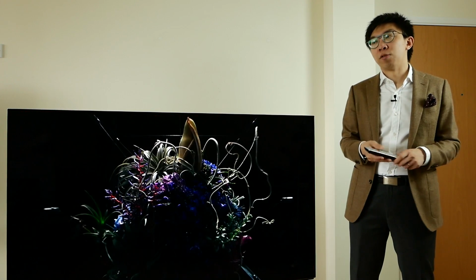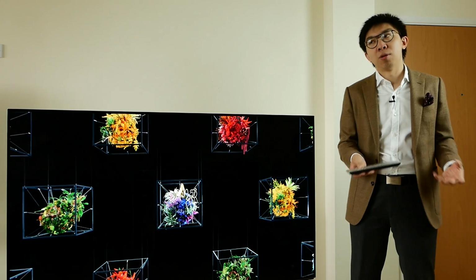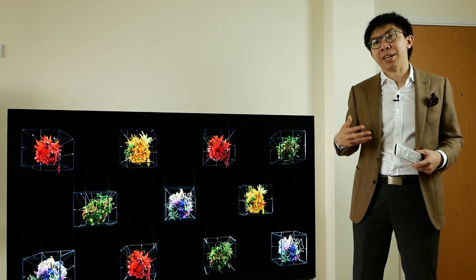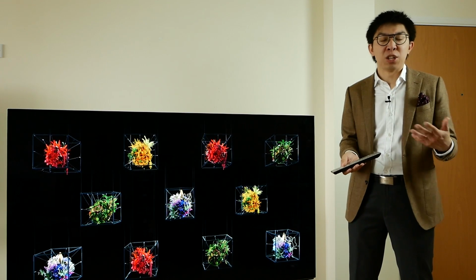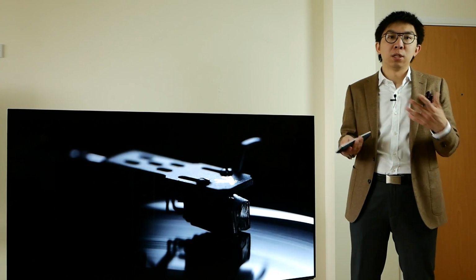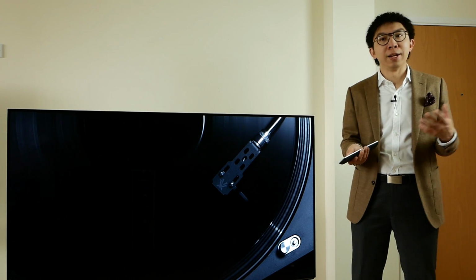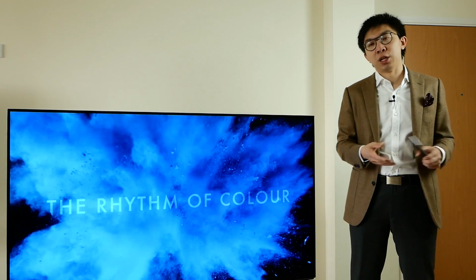These near black uniformity issues are unavoidable for the current state of WRGB OLED, and in light of OLED's other strengths of true blacks, rich colors, wide viewing angles, granted by the technology's self-illuminating characteristics, on balance, I think that is a more than worthwhile trade-off to have these dark bands. The sensitivity depends from individual to individual, but it's not as if LED LCDs are free of uniformity issues either.